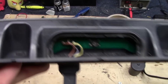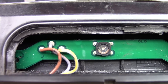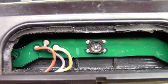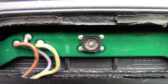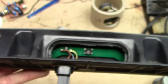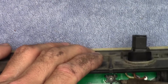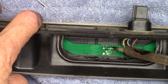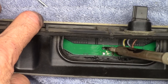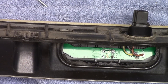Okay, we're here at the electronics bench now. There's the switch — it's just a simple momentary contact, tiny little switch, and it solders on there with four connections. I think I could probably heat up each one of those and pop it out of there right where it sits without taking this entire thing all apart. So I'm going to give that a shot first. Well, I got the switch off. I don't know if I'm going to be able to push the switch all the way back through those holes, but if I can just get it to solder in place, then I have a useful switch. That simple.